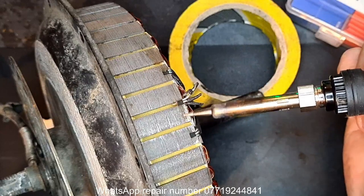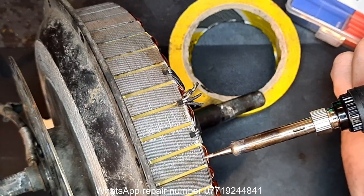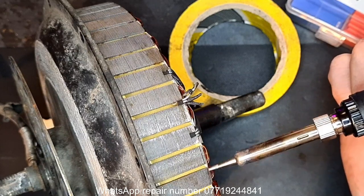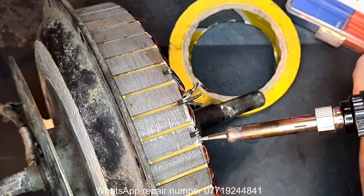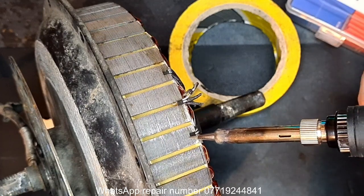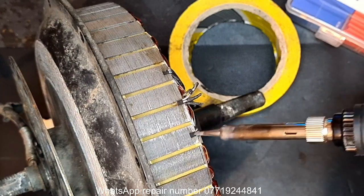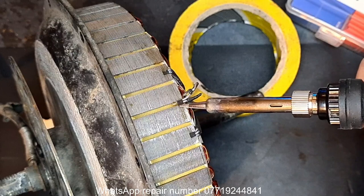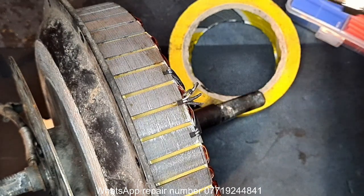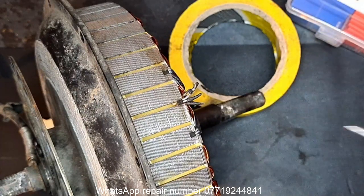So if I go hitting this now to get this out, these plates will separate. As you can see here, these have started to separate. I've seen people do some serious damage knocking them out trying to get these ones out, because what they tend to do is come under the inside with a screwdriver or something, because these won't pull out. And they tap it and they fray all this. There's a way of getting these ones out nicely, but luckily enough, it's the middle sensor, which in most cases is the same in most motors, and we can get rid of this in a nice cheeky way.